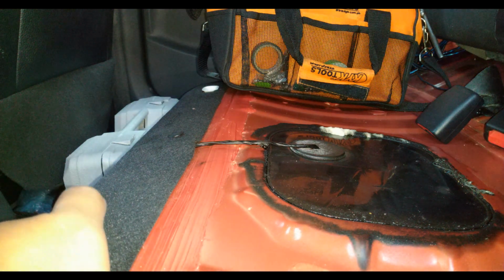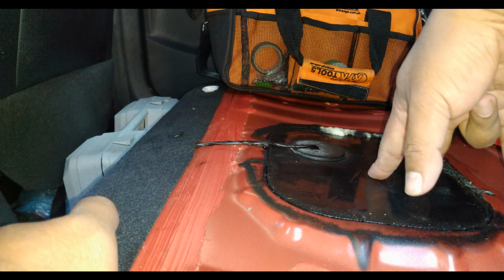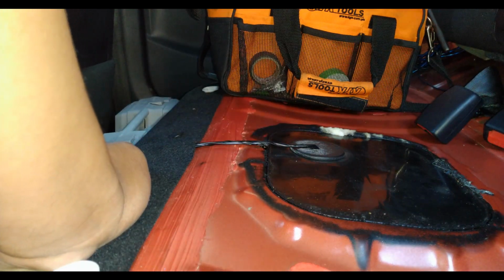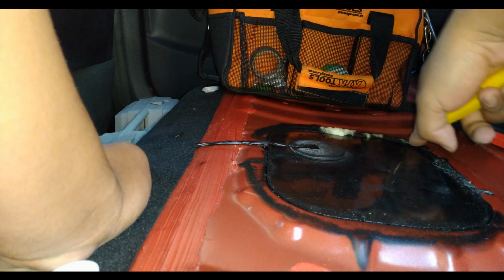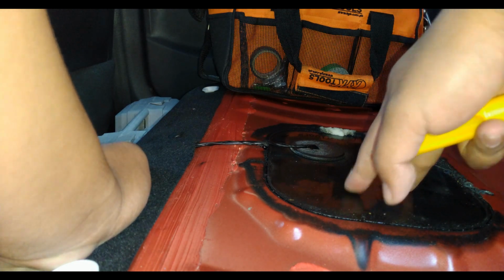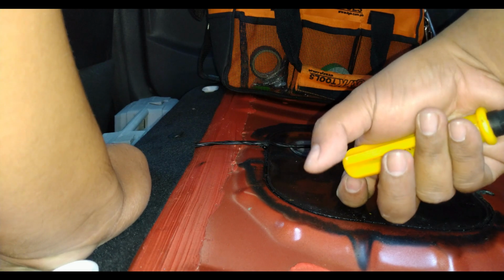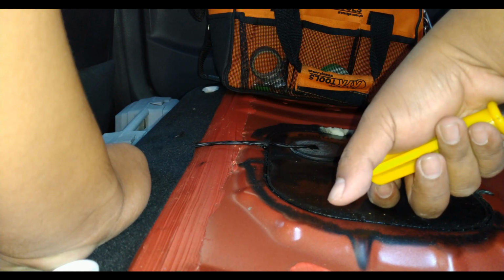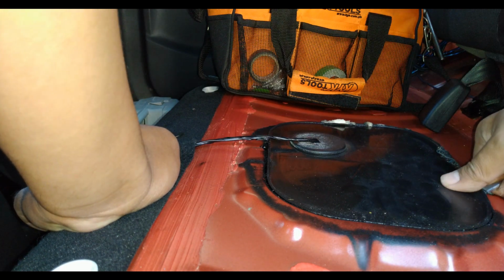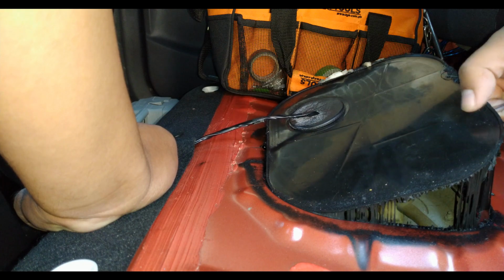First thing that we will need to do is remove the cover that is in between your assembly and the gas tank. This is actually just a cover. You would still need to remove some screws underneath it. If you notice, there is insulation around it. Why? This is actually a safety feature that helps the passengers inside, in case fumes escape from the gas tank, and vice versa. Just be careful with the insulation because we want to retain that seal after we return the cover.